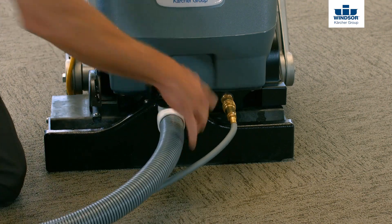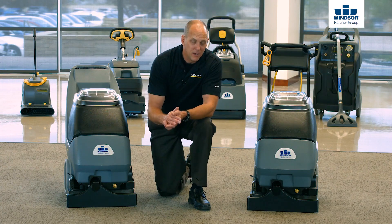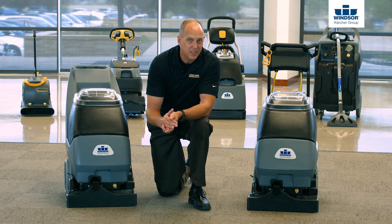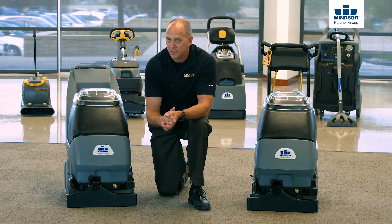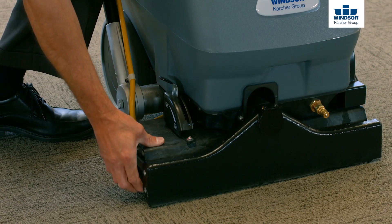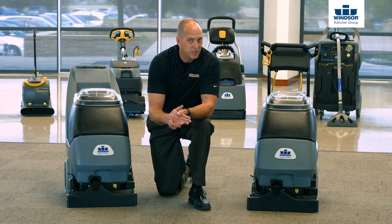When it comes to the vac shoe itself, it's important to make sure you're choosing a unit where the vac shoe and the brush operate independently. There's not an even floor anywhere, so if we have a rigid vac shoe, you'll catch the highs but miss the lows, which will lead to streaking due to inconsistent dry times. Simply grab the vac shoe, pull up on one side, and see if it's spring loaded. Try that before you buy an extractor, because if the vac shoe and the brush don't operate independently, you're not going to get the results you're hoping to achieve.